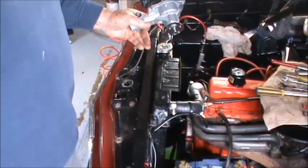All right, so that's drilled out now. I managed to do it upside down, so I didn't make a mess on any of the gasket or anything like that. I did notice that it looked like it had been dropped when I turned it. It was sort of dragging a little bit, and I could see two marks which lined up, and I just had to move two of those impellers just a tiny little bit where they were bent and just dragging on that. Now it's nice and free. So looks like somebody may have mishandled it slightly at some stage. All right, well, bung this sucker on, eh?